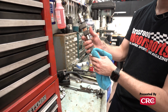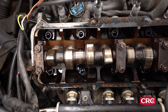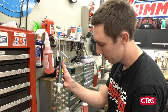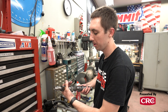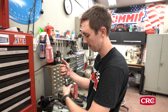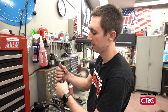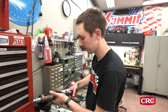Usually these come coated in some kind of protective oil to keep them from rusting, and I don't know where that oil came from or what's really in it, so it's no good for my engine even though it's just the base engine. Now we've got some CRC engine assembly lube and I'm going to coat this cam in it. Assembly lube's role is to lubricate things for the first couple of seconds after you first start an engine you just put together — otherwise you'd have bare clean metal on bare clean metal, which is absolutely not what you want in an engine. This will protect it for the first start-up until fresh oil can get up there.